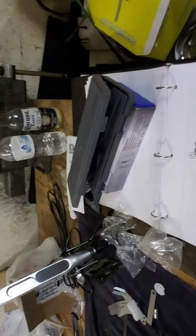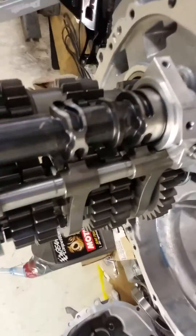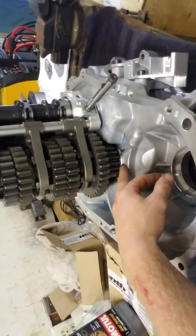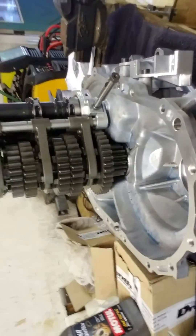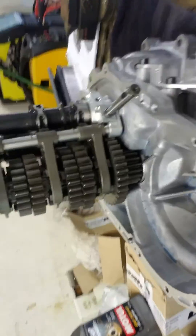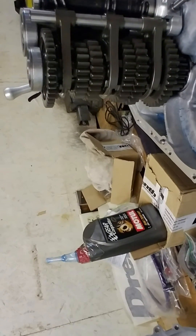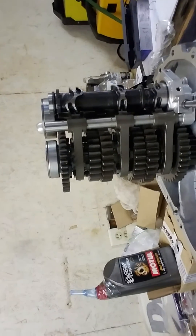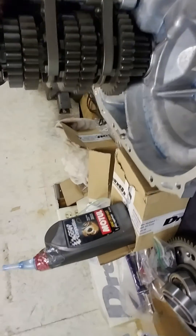I think that's about it. I've got my instruction book — read that several times. Got a brand new OEM case half. It's kind of important to start with that, because they say over time, if you're starting with a used one, the bearing seats can actually oval out, so you'd have to bore them out and run an oversized bearing. We're running a brand new OEM case half — they're actually not that expensive, only about 400 bucks for a brand new one. Hopefully we'll get this in the car in a few days and see how it goes. Alright, thanks for watching.